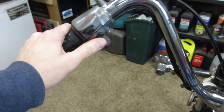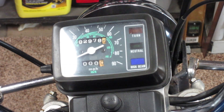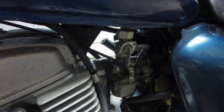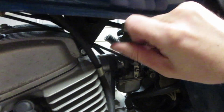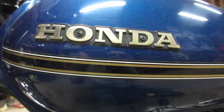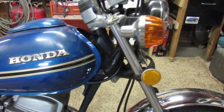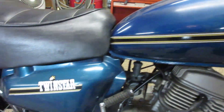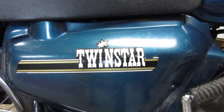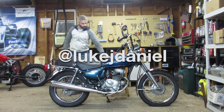I'm going to go ahead and give it a good once-over in a coming video — drain the oil, refill it, do the spark plugs, then put a new battery in it and see if I can't get it started. I may also pull the carb just to take a look and see how it's doing. Now that we see it's in fairly good condition, the next step is to give it a good once-over and get it road-worthy. I'm not sure how far I want to go in terms of modifying it or making it cool — maybe I'll leave that up to my wife. Thanks again for watching, and I hope to see you next time.